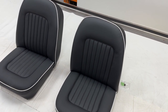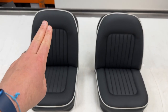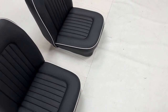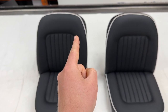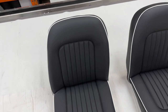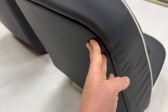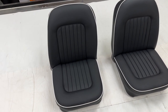A few things to note on the TR4A frames and covers: they are handed. The cushion bases are not — they are universal — but the backrests are. This one here is actually the right hand as you're sat in the car, and this is the left hand. The covers themselves are handed — you'll see it's much narrower on the horseshoe on the outside than on the inside. That's to allow the hood frame to pass by without scuffing the seats, a very common theme on TR4s and TR6 seats. It does affect this back panel here, which is a hardboard panel trimmed and attached on — that is also handed.